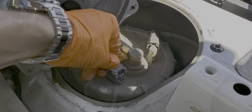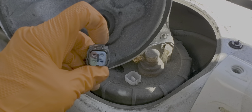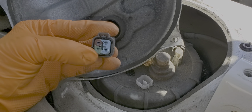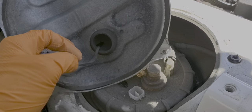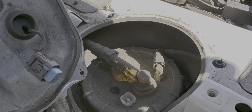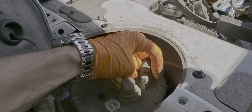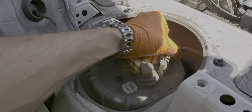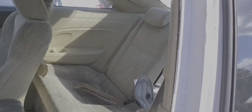Let's take a look at the wiring. We're going to disconnect this by pushing in on this tab and lifting up. With this part of the connector up, the upper left portion receives power from the fuel pump relay when it's energized; the lower left portion receives a constant ground at all times. That's how you can check the circuit there. If you determine that you're getting power and ground here but the fuel pump's not providing any pressure, you can actually remove the fuel pump through this access — you just have to disconnect the lines.